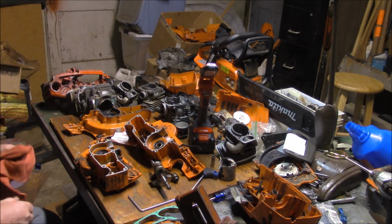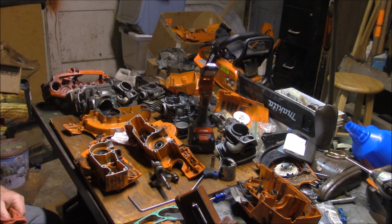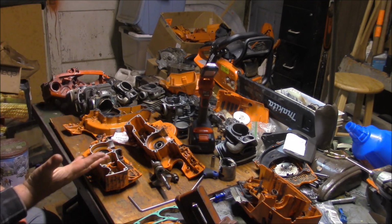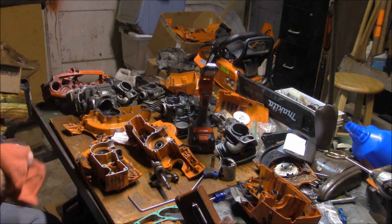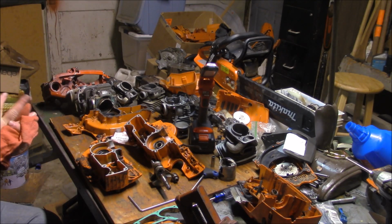But how that affected me is I always put steels in these things, unless they already have them like this one does. I always put steel locating pins. I always glue the cases together with 1184 plus a gasket. I always put the case screws in with 1184, which kind of glues them together. I just did that instinctively, but that might have been one of the reasons. Little things like that added up to a more reliable build.